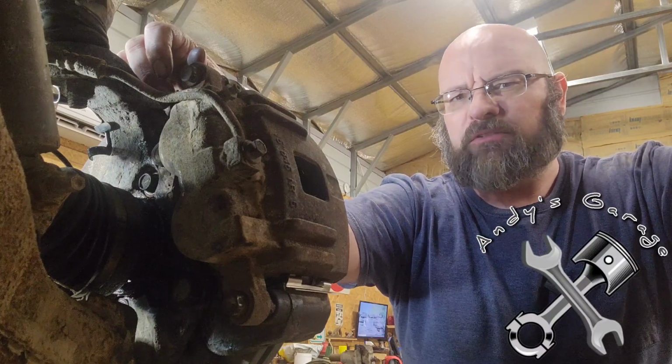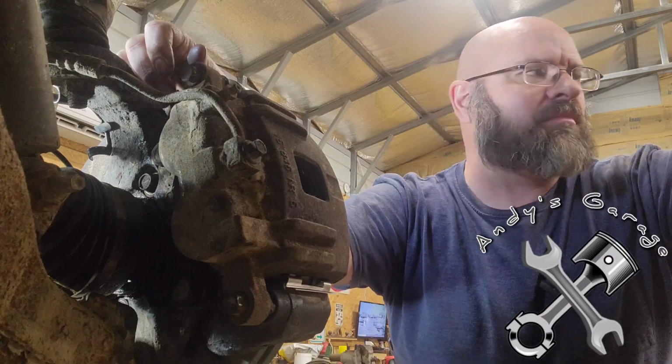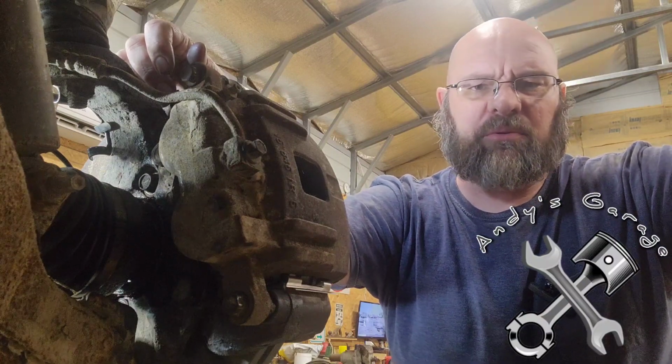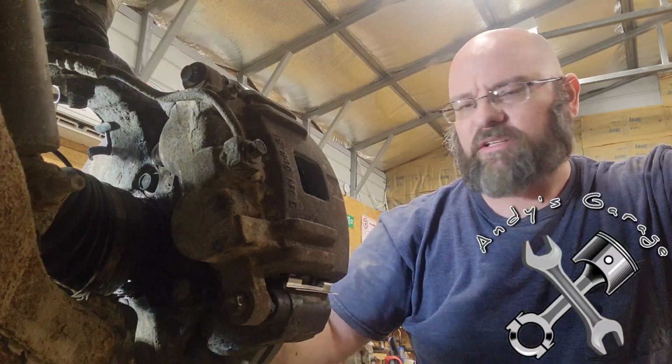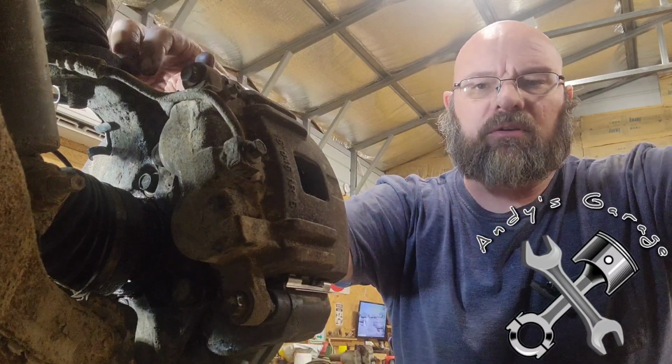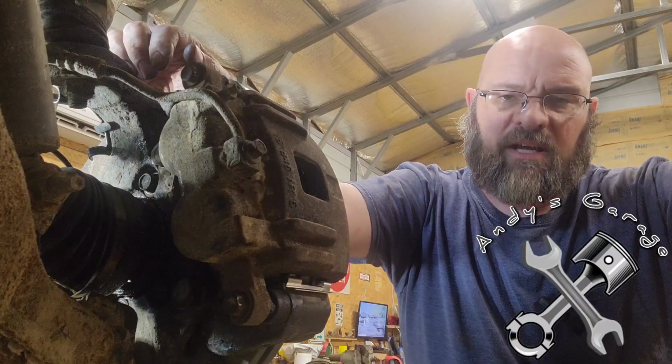Torque spec on the tires is 90 pounds, but it's a small truck, and I'm gonna do 100 anyway because I feel comfortable with 100. And this thing is a 6 lug, so I'm gonna go ahead and torque them at 100. But torque spec says 90.